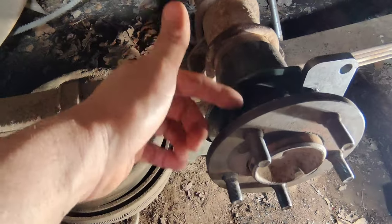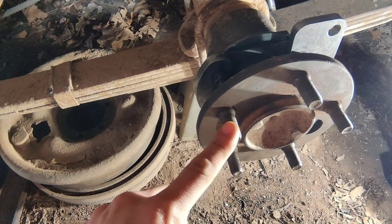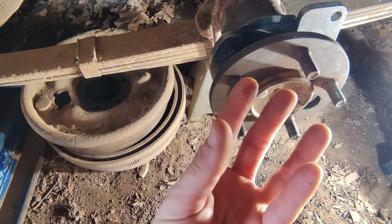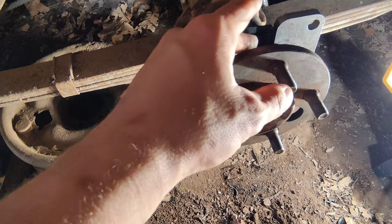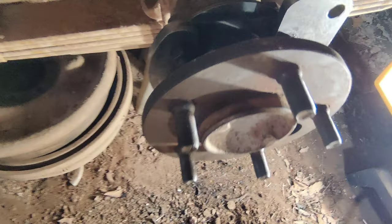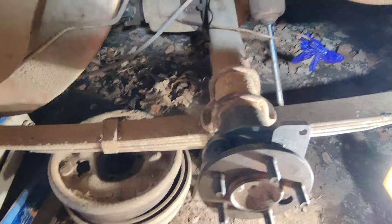I did have to finesse each hole just a little bit because I noticed with the studs, I'm going to use these as an example, the actual axle retainers, with them being a little bit longer seems to exaggerate the pitch in just a little bit like that, so I had to basically soften or oblong the holes with the drill, but overall it works. It's got a nice tight, clean, crisp fit. Now we can work on getting the dog bone set up and then get our calipers mounted.